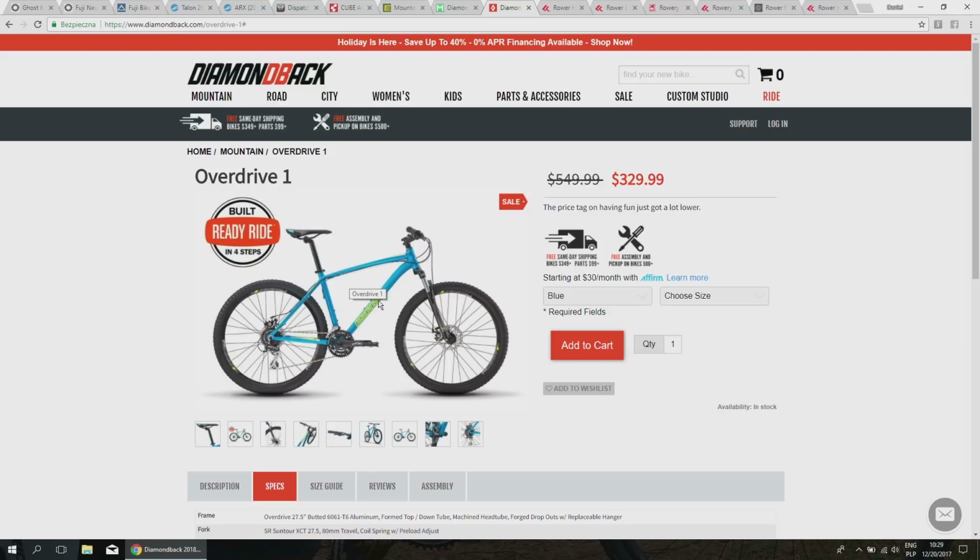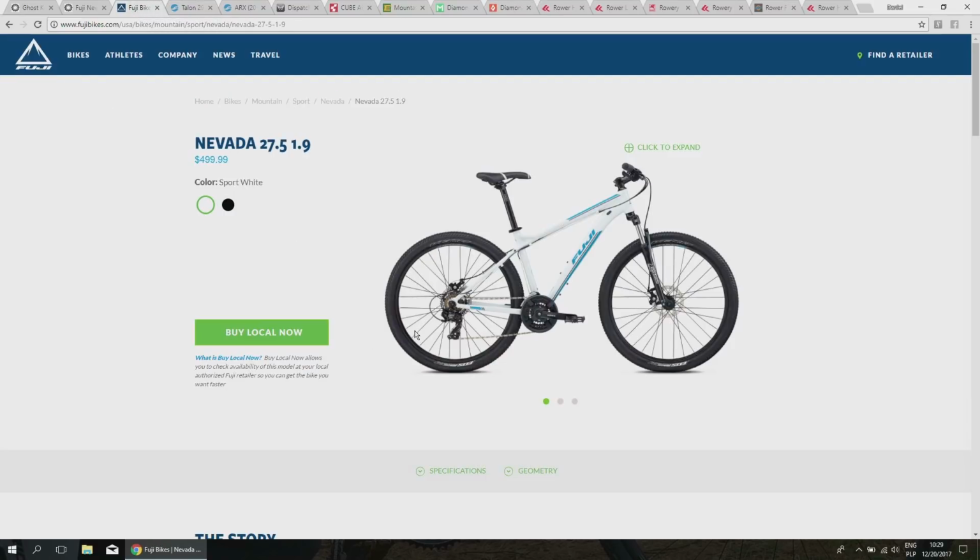At the end I said some upgrade ideas. So on any of these bikes which had the Shimano Tourney derailleur, I would replace it with, let's say, if you already replaced, then don't go just for Acera, go for Alivio. Alivio will have much more stable springs. So Tourney is pretty bad in this matter, so I would go for Alivio. And the next upgrade, that would be the first probably, is changing the saddle to the saddle that fits you, and maybe some foam grips on the handlebars.